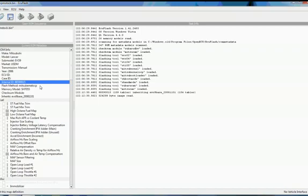when someone is referring to a specific table address or a specific modification for an Evo ECU, they're probably going to associate that with a specific ROM ID or a specific ROM version. And if someone has released information pertaining to the 88590015 Evo 9 ECU, it probably won't apply to you if you don't have that same ROM ID. There are a few exceptions.